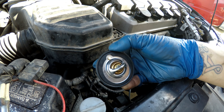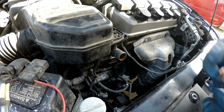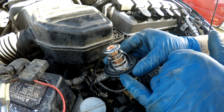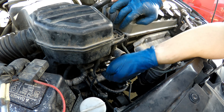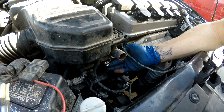We're going to put our new gasket on our new thermostat. This little bleed port is going to go upwards. I'll install a picture right here of the guide slots that are on the head — we're going to make sure the two nubs match in those slots. And there you go, it's lined up. Now we can put our thermostat housing back on.